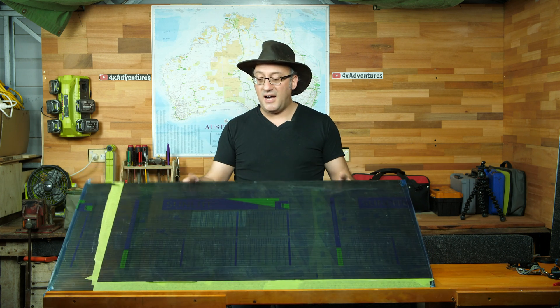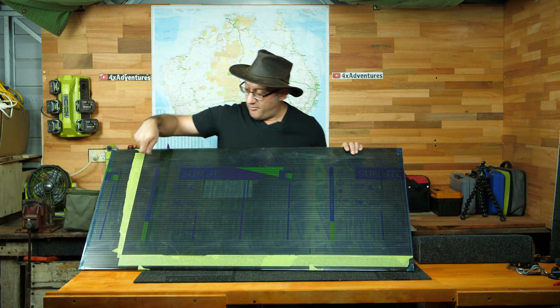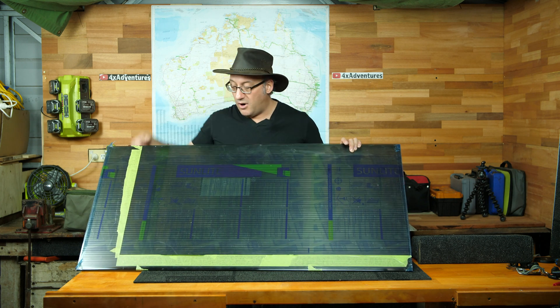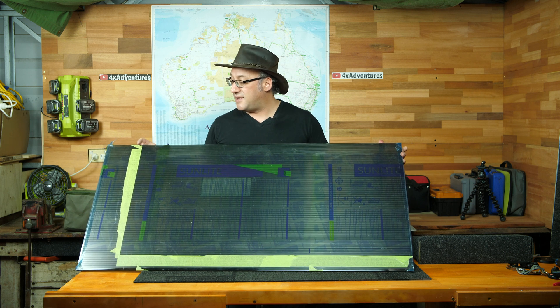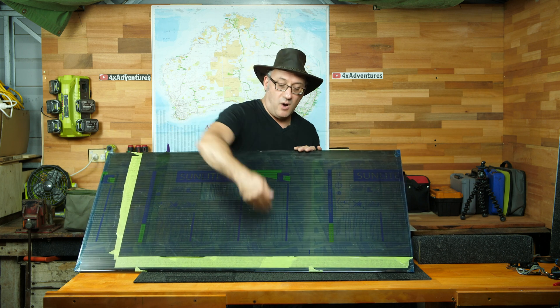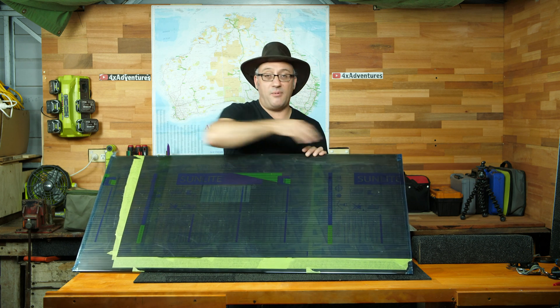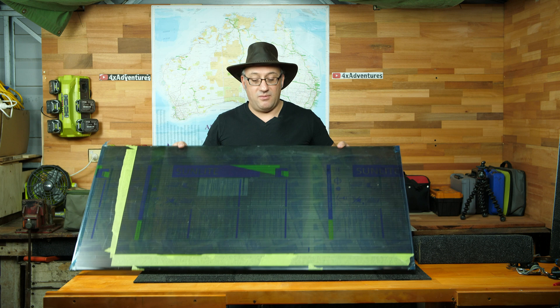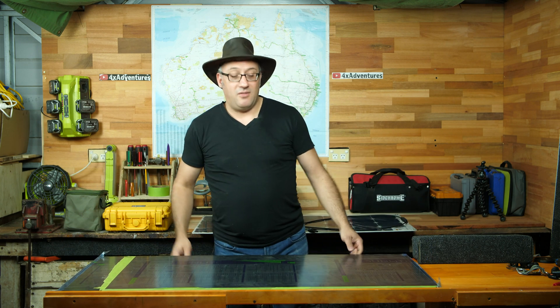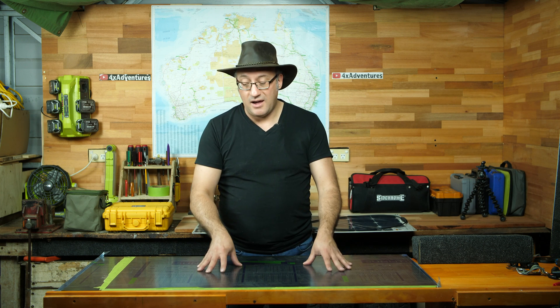What I'm going to do is cut this slightly larger than the solar panel. I have marked out the line where I'm going to cut it — about two millimeters longer and two millimeters wider than the solar panel, so I'll end up with a millimetre extra polycarbonate sheet on all four sides. The solar panel will be mounted to this, and once the glue has dried, this will be mounted to the four-wheel drive tent.